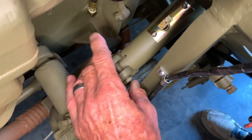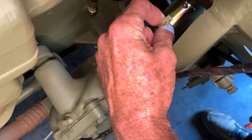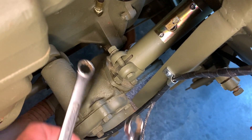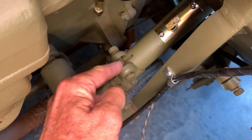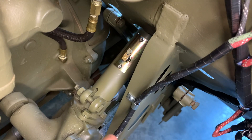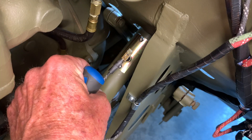Line that slot up right at the top where your steering box is, keeping the column in the same position as shown. You want the brush slightly offset but not contacting anything else or touching any wires after you connect it to your horn wiring. Use two box-end/open-end wrenches — half-inch — and tighten that clamp so it really snugs down on the steering tube cover. Keep that slot just slightly off to the right. You don't want anything touching that horn brush or that wire.